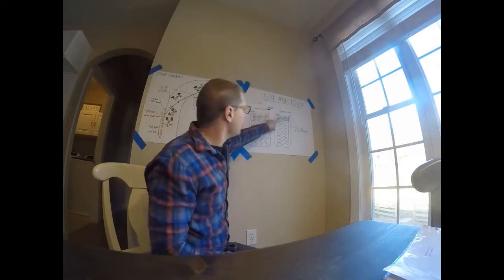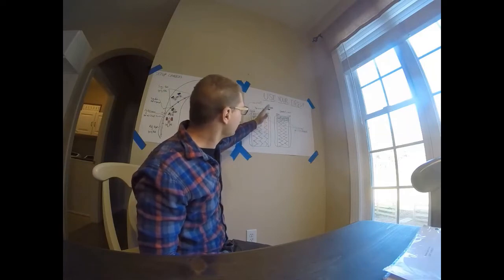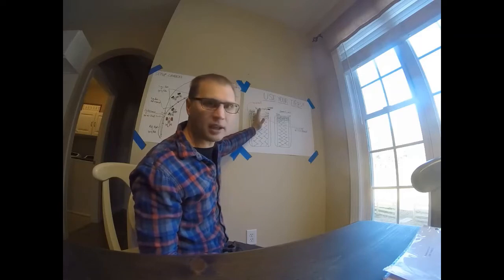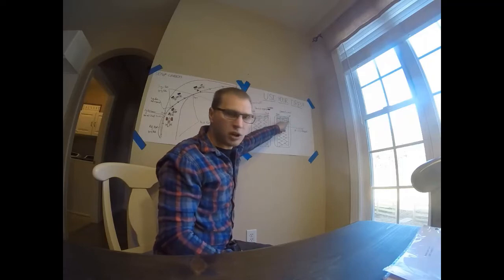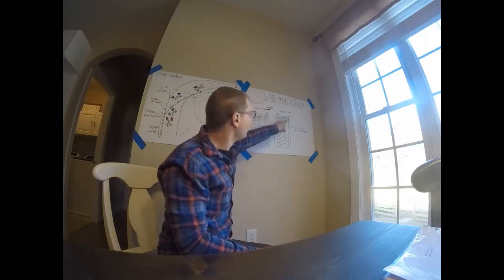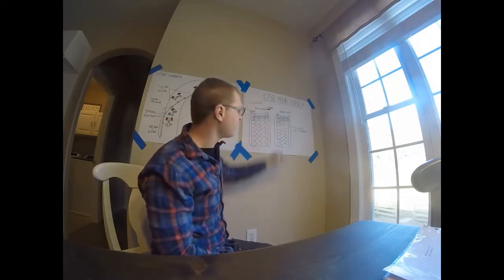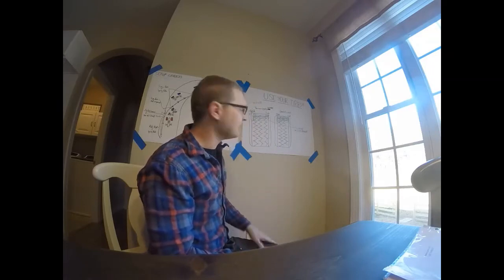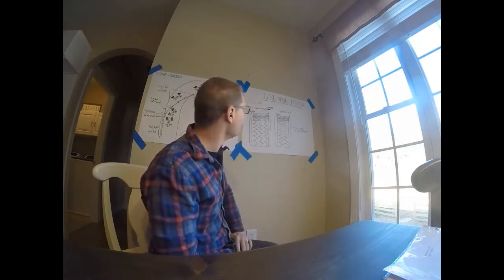What I like to do is I would then stand my tire up a little bit more. So let's say that we're negative 3/4 of a degree here. I would stand it up to negative 1/4 of a degree and see what that looks like. If you notice when you come in from a session and your tires are hot and you've got this graining, a little lip over here, and the graining looks pretty consistent and it comes real nice and close to this outside edge, you're using all the tires you've got, that's really pretty close on your camber setup as far as that goes.